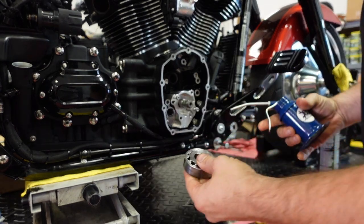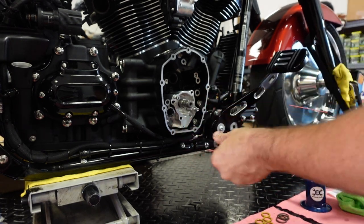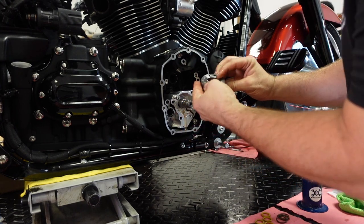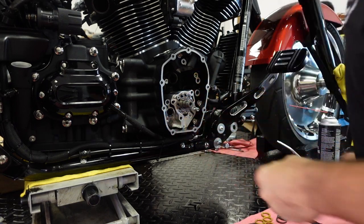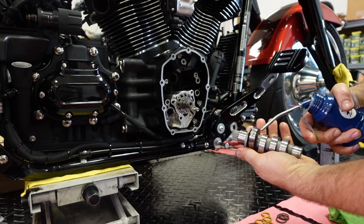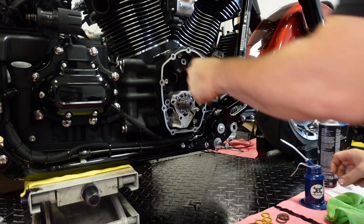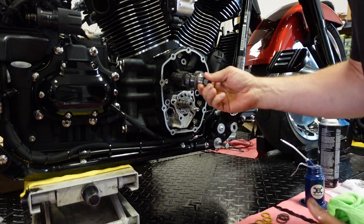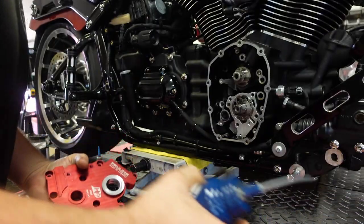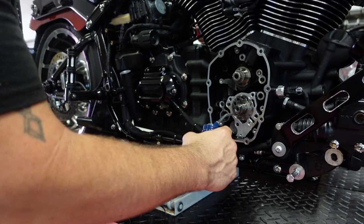The feed pump gets lubed — usually I use assembly lube, but this has already been installed so I'm going to be starting it up pretty quickly. Make sure the pump body itself is lubed, and then this rotor assembly will go on. It's important to put it on the way it came off. Now I'm going to lube up the T-man performance cam. These parts have all been installed before, so I know they're clearanced — I don't have to worry about checking clearances. Then lube up the cam bearing and install the camshaft. Just spin it to make sure everything is still good.